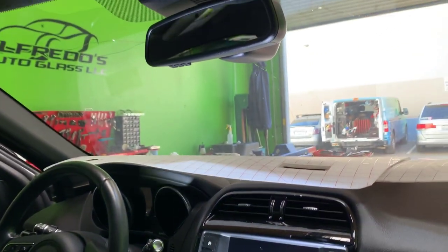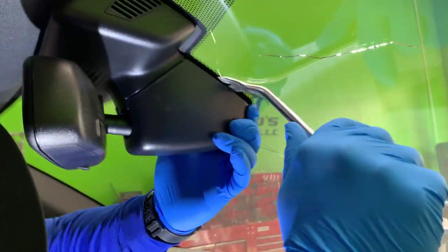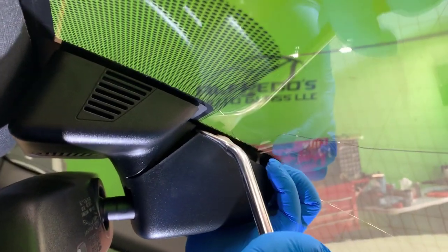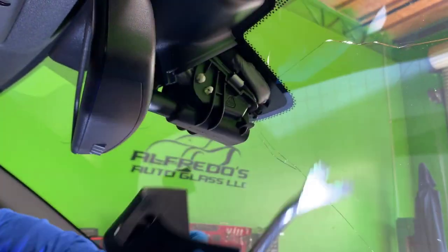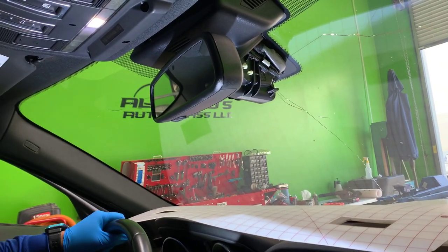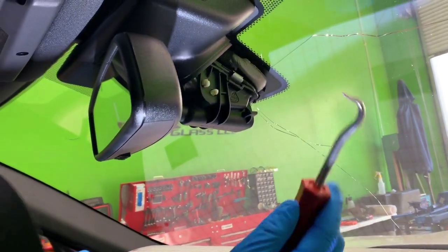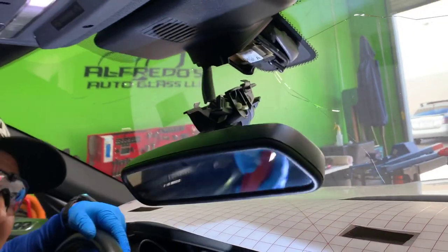This one's similar to a Chrysler. Let's start by removing the lower bottom cover — it comes down towards you. Go very soft. It already came out from this side. I'm just pulling it down. This is what goes into the bracket — remove that. I always like to place the parts in the backseat, get them out of the way. Now this removes the rearview mirror — it looks like a European style. Grab a hook tool and it comes right off.